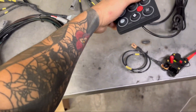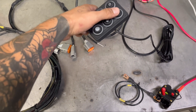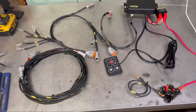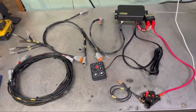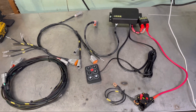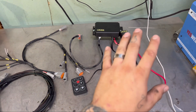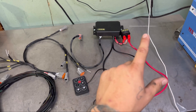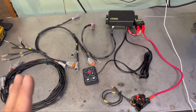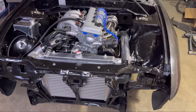The Canvas panel is going to be controlling the ECU power, fuel pump, fuel pump button, fan one, fan two, as well as two accessories. It's going to have radio, full chassis harness going to the front and rear, brand new everything, a micro-tucked battery. This chassis harness also utilizes a main relay so the main box is protected — any extra amperage gets pulled from the main relay. It's all Tefzel M22759.